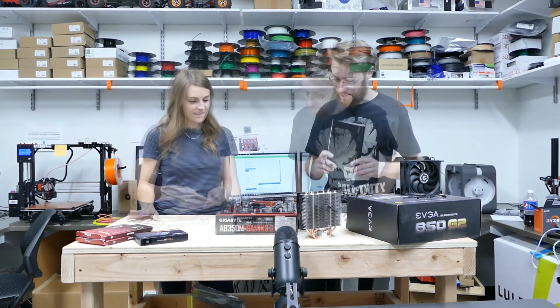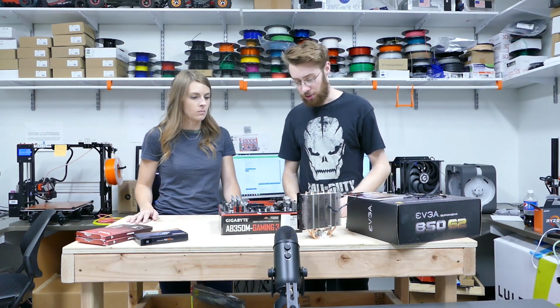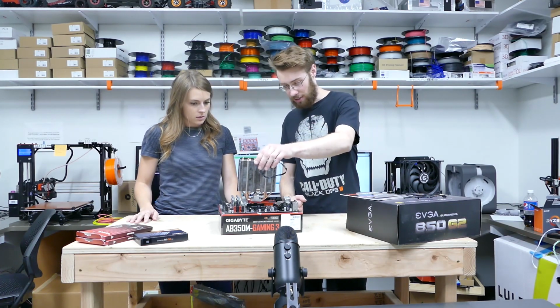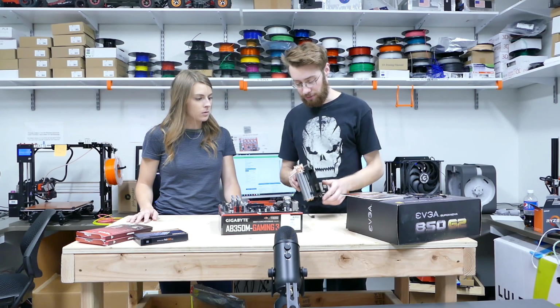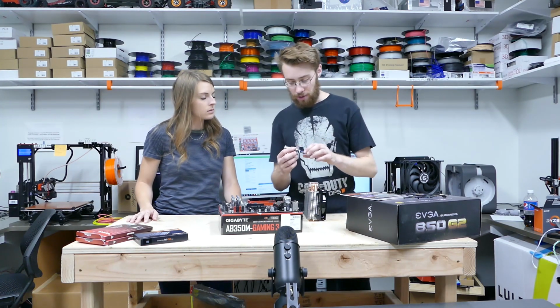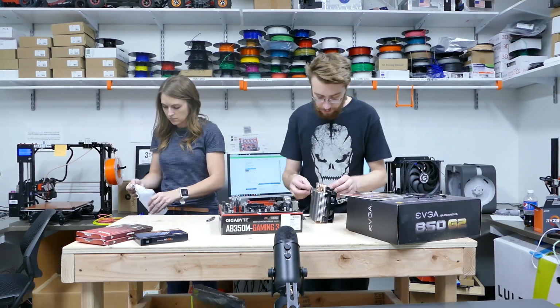Yeah, that is. So next thing we need to do is we need to cool the CPU. So the CPU gives off a lot of heat. So this is why we have this. The issue is if we put this on top, there might be some air gaps between the copper and this guy. And so that's where a thermal compound comes in. Yeah. So this guy kind of fills in the air gap in between the CPU and the cooler and makes a really good contact.